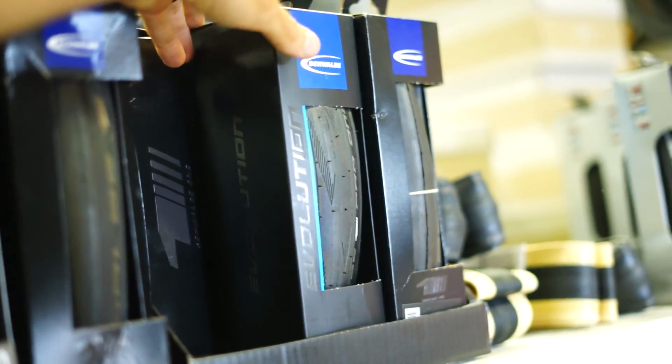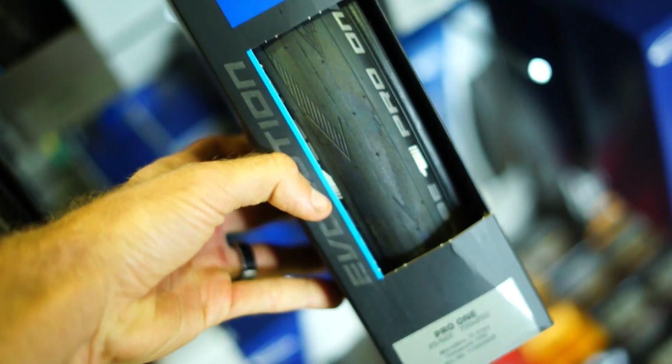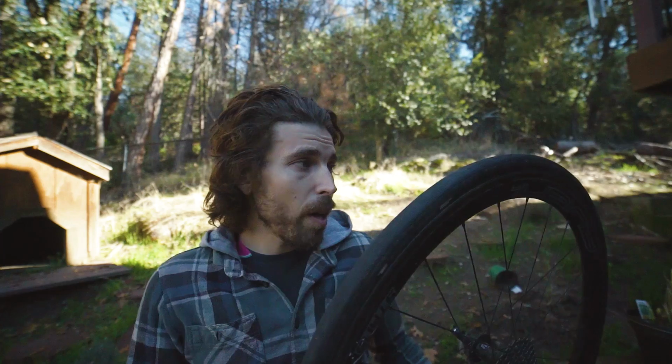I just grabbed some tires from the garage, not tubeless. And so it wasn't gonna work. So I went to the store and I got actual tubeless ready tires. These ones that I'm running on here. And as soon as I got them, they went on super easy. I didn't need a compressor. Some people with certain rims and certain tires, I guess you need a full-on tire compressor to actually get enough PSI to pop the bead. This I can do with a floor pump, no worries. So then I take out the valve stem, put some sealant in, and then you're ready to go.